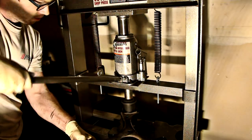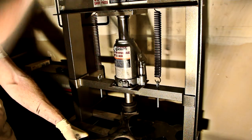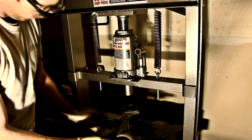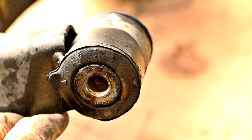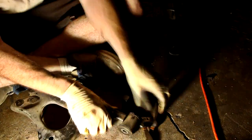Eventually the bushing will lose its grip on the control arm and slide out freely — that's the front position bushing out. Now it's time to tackle the rear position bushing. The factory bushing sort of mushrooms over the edges of the control arm, which can make pressing it out kind of tricky. I found it best to take a razor blade and cut off the excess rubber material to help press it out.